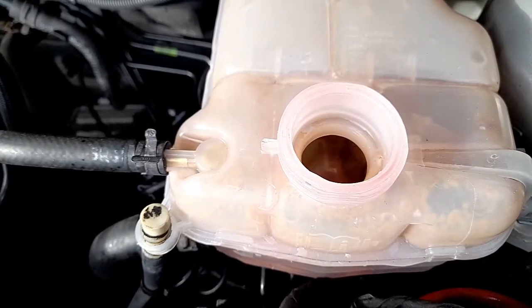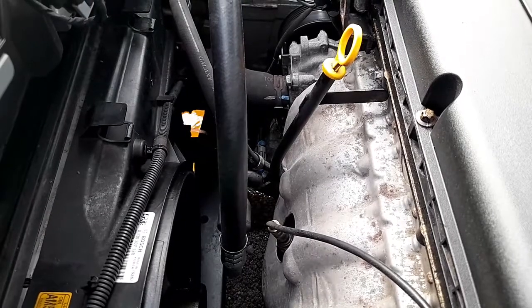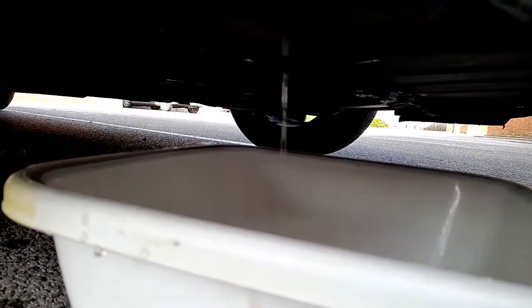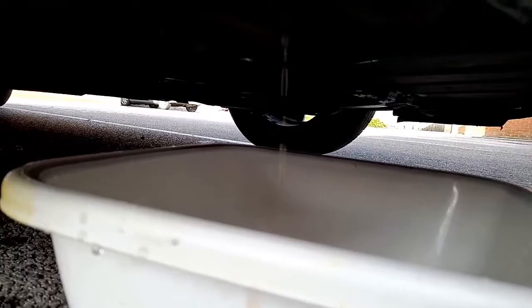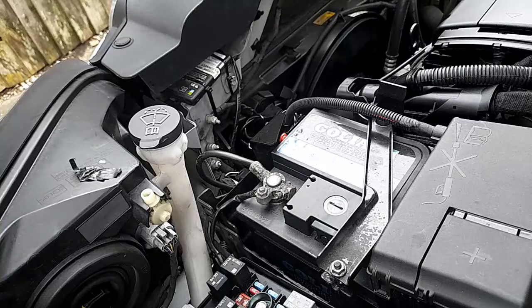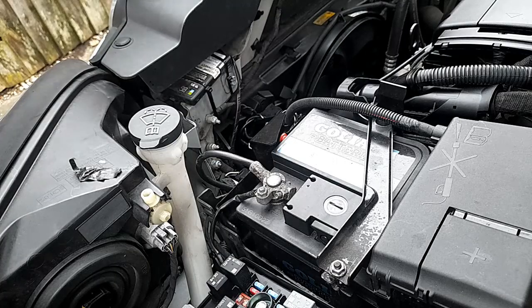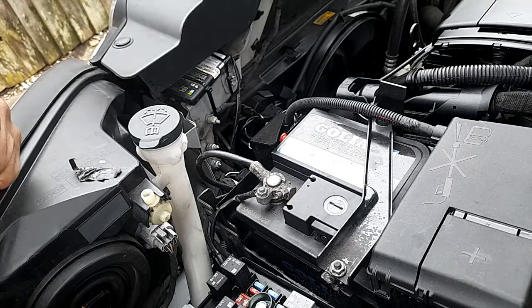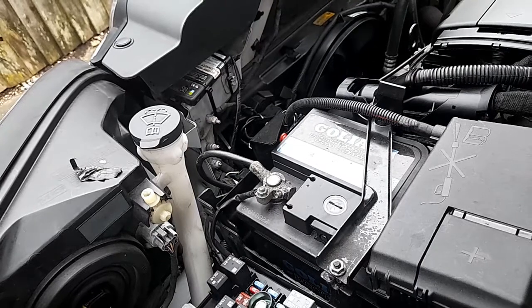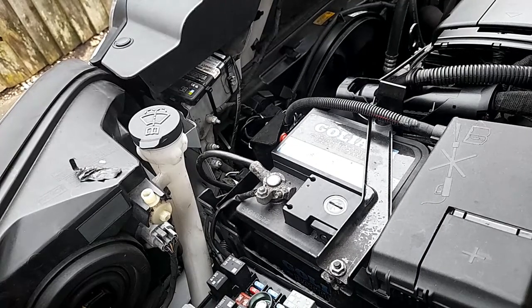What I've done now is change the coolant — I flushed it and put in new coolant. I had a car like this before where I was using non-antifreeze water, or mixing them, and I had issues with overheating and the fan as well. After changing the coolant, the fan doesn't come on now except when I put the air conditioning on.